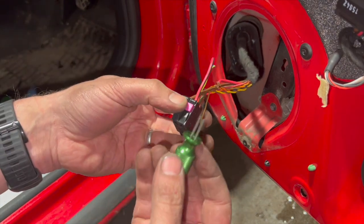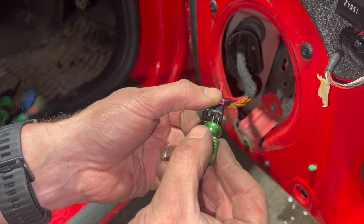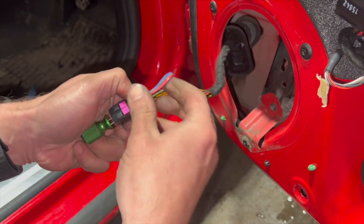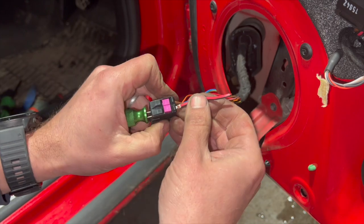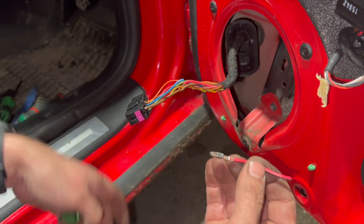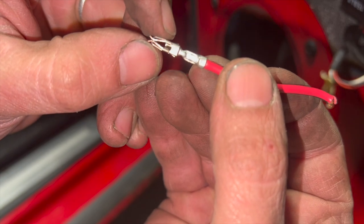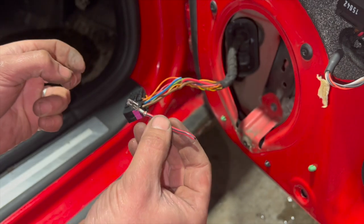And basically for that first one, I've got this style of terminal tool, and all it needs to do is go in on each side of the bit there. It does take a bit of jiggling to get it to go in properly. And you just hold it in, and then you can release the pin. All that does on the terminal is press on a little lug either side. Just see them two bits that are sticking out. That simply presses on them so that you can release the pin there.